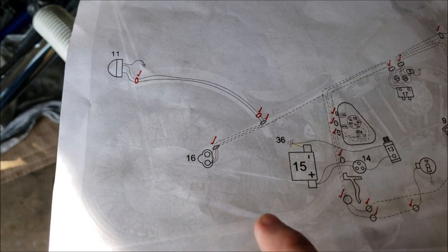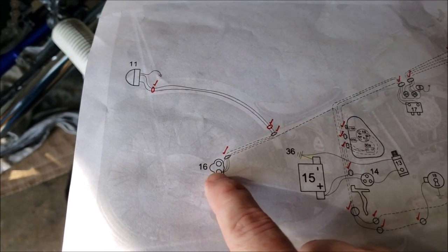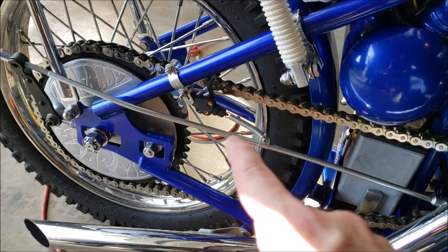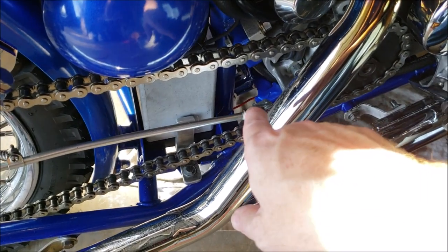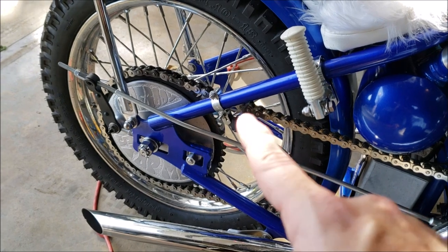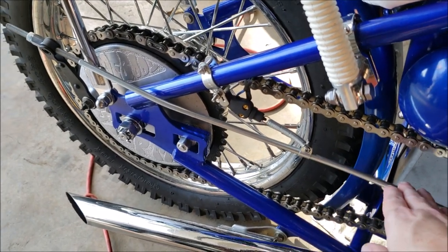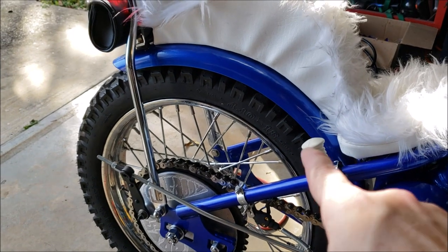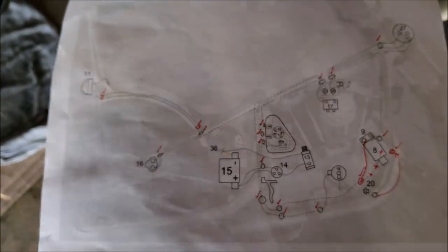Number 15 is the battery. All these numbers, by the way, are just the codes from the factory manual. This is the rear brake light switch — right now I'm running one of the cheapo pull-string type switches. I wanted to replace that with a button-type switch hooked to the brake linkage the way it was intended, but I ran out of time before the bike shows. When the rear brake rod is pulled forward by the pedal, it pulls on this spring, connects the circuit, and sends power up under the fender to the tail light.